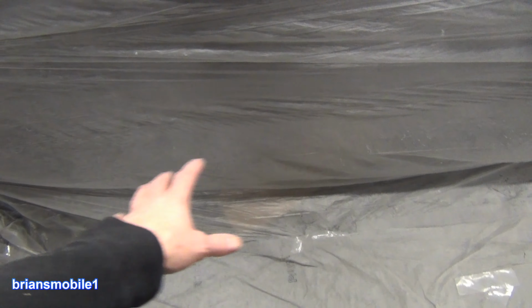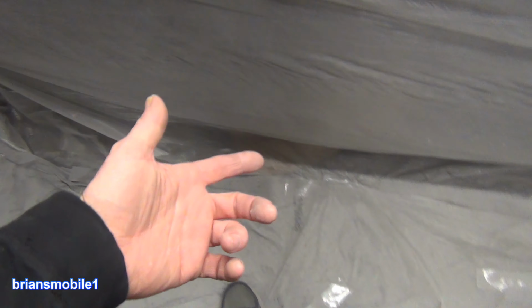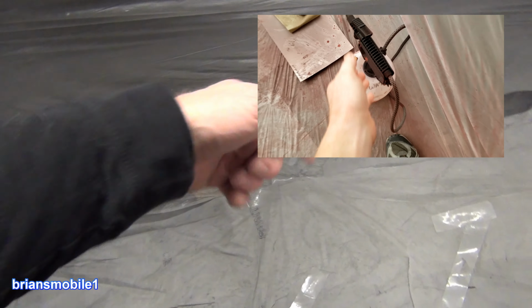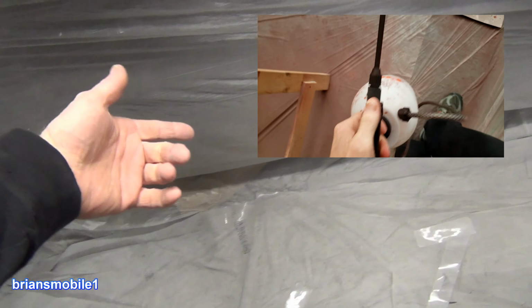You're watching a demonstration of the HDX plastic that I was talking about from version 1. It's just really tough. Best thing you can do is when you do your walls, pull them tight like I say, but also tape them to the floor, or you can get a board or something and lay the board on it, and that'll hold it down. And then you take your watering can or a sprayer, like those little 1-gallon pump sprayers, and just spray along the crack of it, and this plastic will stick to it and it'll seal it up really good.